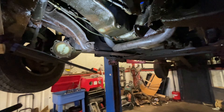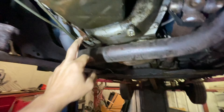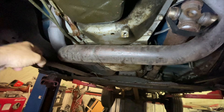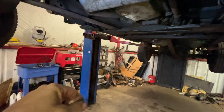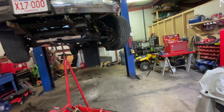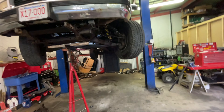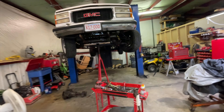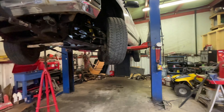I ended up putting some mystery oil into the cylinders and took all the spark plugs out after the motor was seized. I loosened this cover enough and took the starter off to get a pry bar in here to be able to grab the teeth of the flywheel. I was actually able to free up the motor and get it to spin a little bit. Once I got a full revolution out of it, I connected the starter back, hooked up a jump box and I got it to turn over. I turned it over for a couple of minutes until I built up oil pressure again to make sure all the oil lines were full. I started it up, put the spark plugs back in, and it ran great - no knocking noises or anything.